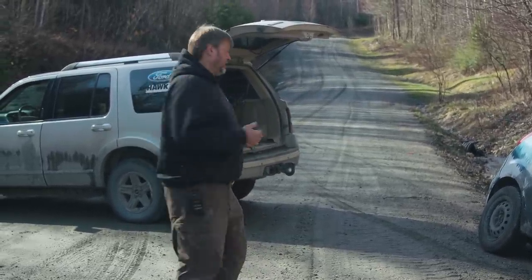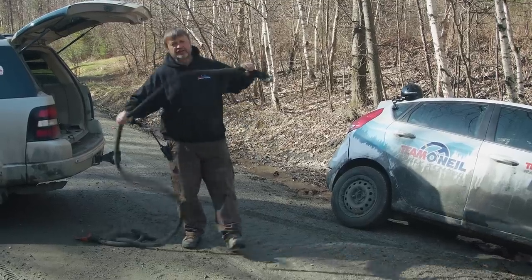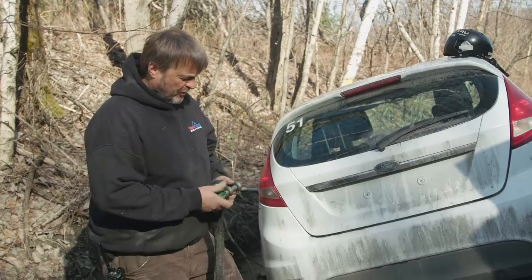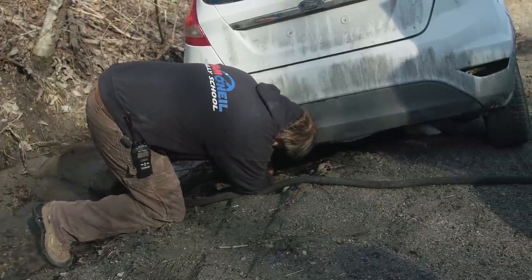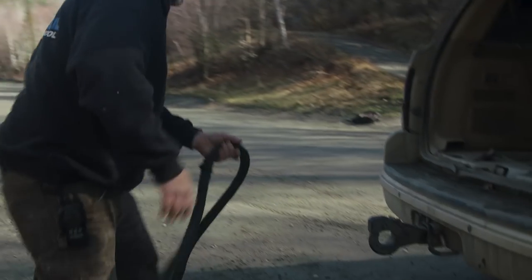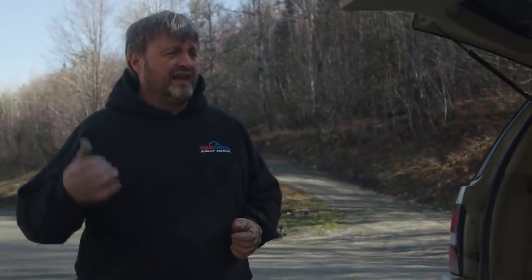I'm going to use a stretchable kinetic rope that has a certain amount of give in it. What it does is it uses the energy of the weight of this vehicle to pull this vehicle out. It stretches and once it starts to pull that stretch back, it pulls this vehicle up onto the road. So we're going to use the weight of this vehicle to pull this one. I've got a bow shackle here, I'm going to hook up to the recovery point, and then I'll hook my recovery rope to the tow jaw here. We want to use approved recovery equipment and recovery points for the type of work we're doing. Using kinetic energy is also a little nicer on the recovery points — it doesn't create so much of a strain.